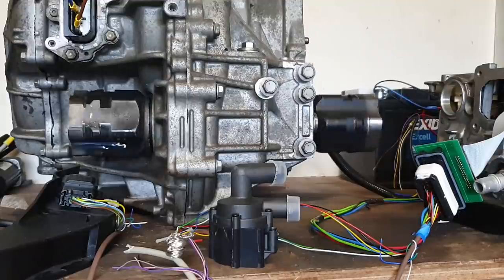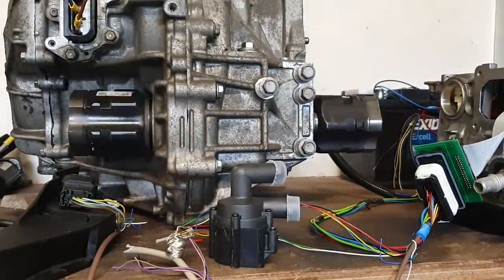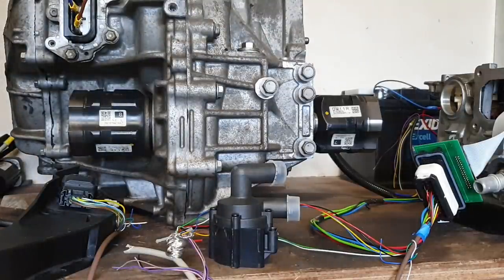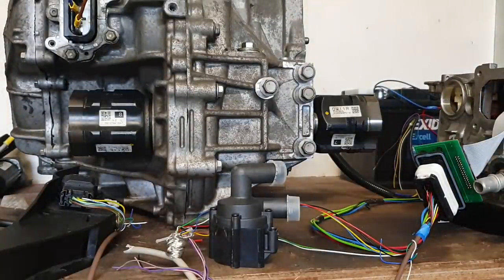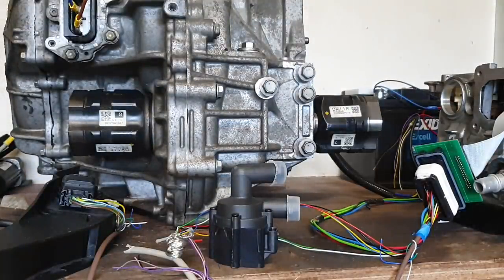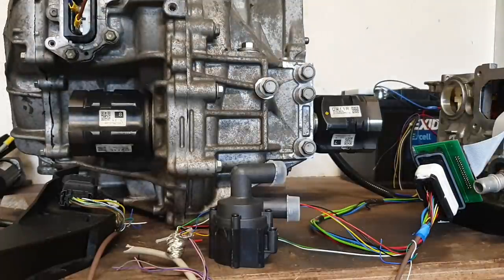And zero. Now, you might have noticed that it did not spin up as quickly or accelerate to as high a speed. That means that we're beginning to approach the curve. We're barely there on that graph. So what I'm going to do now is go back to parameters. I'm going to leave you guys on the motor here. I'm going to change my sync offset to 7,500. Because when I see something like that happen, I have my jump.